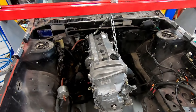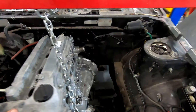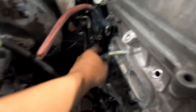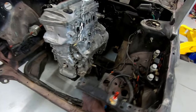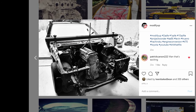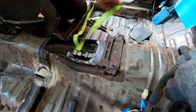And it fits pretty good. As you saw, we had to beat the firewall a couple of times, but yeah there seems to be enough space for everything. The only thing is we will have to cut the firewall down there so that we can fit the starter motor in. I expected we'd have to do that, but overall it fits quite nicely. Once it's in the bay you can breathe your first sigh of relief, because no doubt you've spent a lot of money just to get to this point. Now's a good time to take pictures for the gram, just to give people a false sense of how fast your build is making progress.